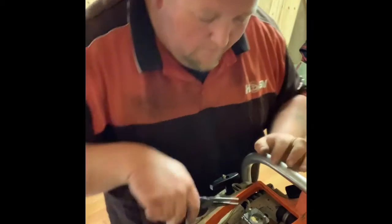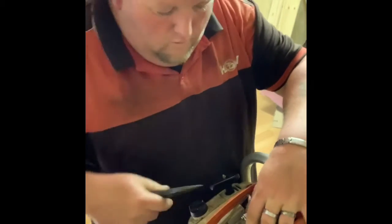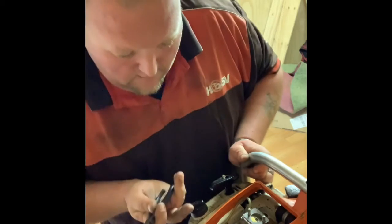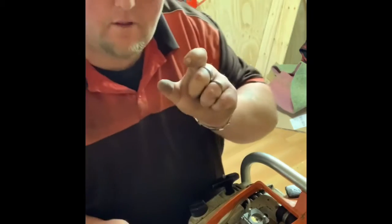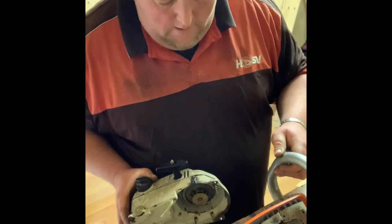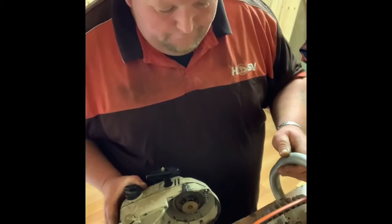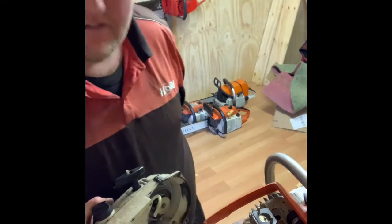Fuel hose, way too long in my opinion. The barb. I'm going to do what I did in the 41. I'll turn it towards the tank and I'll have a fuel hose that long. That's it. Okay. Well. Plastic starter cup. And she's stuffed. Put a new one in that.